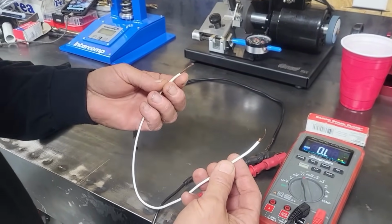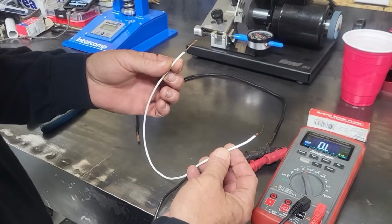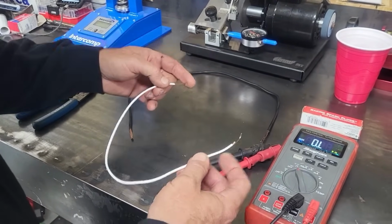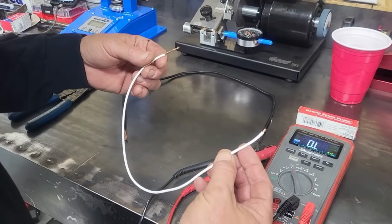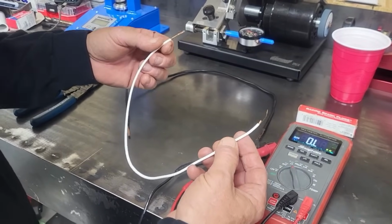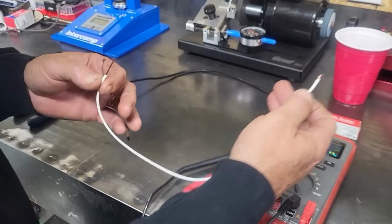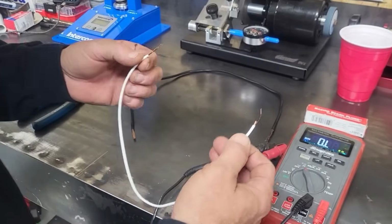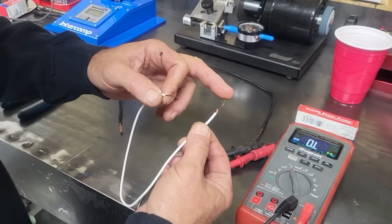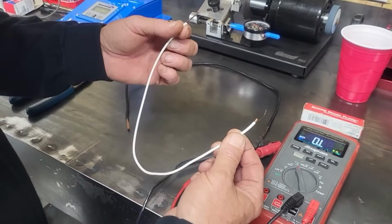Well, the answer is yes. If I hook this to my battery, whatever the battery voltage is reading, let's say it's 12, it will read 12 volts on the other end. But remember the highway scenario with 1,000,000 cars, or was it 1,000 cars, with just a little quarter-mile strip of highway? You're going to bottleneck and everything's going to get hot and melt. If you tried to pass amperage through that little strand, you're going to melt it.